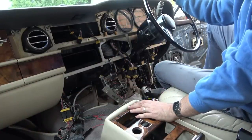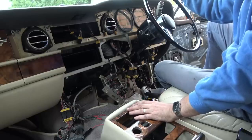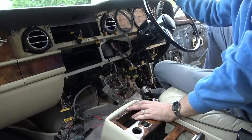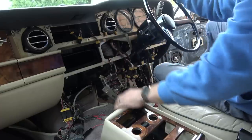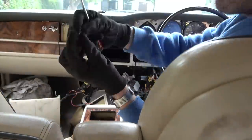It did say to be careful of static shocks. Now, everything always says that, but you kind of know when you work on something like a Nintendo Switch or an Xbox, that 99.9% of the time you're going to be okay. The problem is, this is from the 80s, and I do think static was a big thing back then, and I haven't got a wristband on me, but I suppose I could keep grounding myself on here, couldn't I? And that's going to be getting rid of the static. So they really have buried this board very well, but I do need to get to it just for my own peace of mind to rule it out.